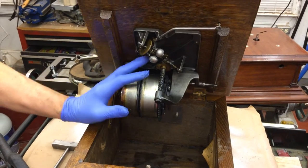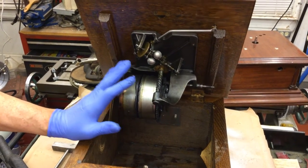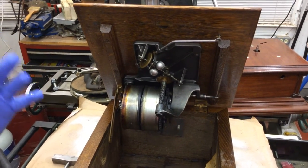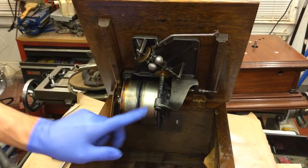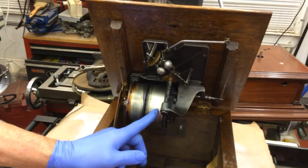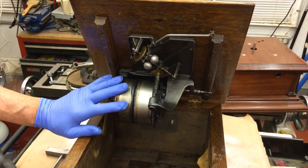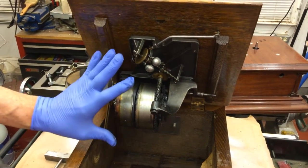This is the same motor as a Victor 1, Victor 2, Victor 3, and it goes on — but the Victor 6 is a different motor. A Victor 2 only has one spring barrel. The 3s and 4s have two spring barrels. But what we have to do is get this off first.